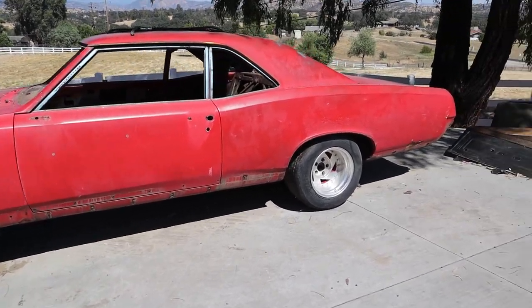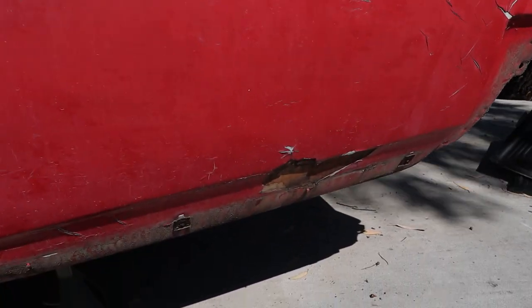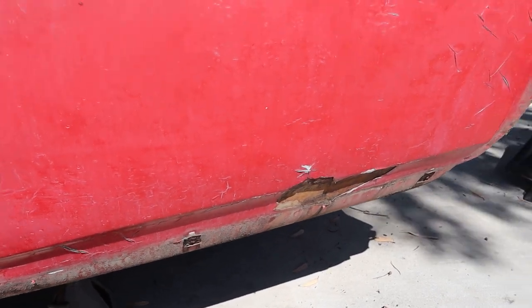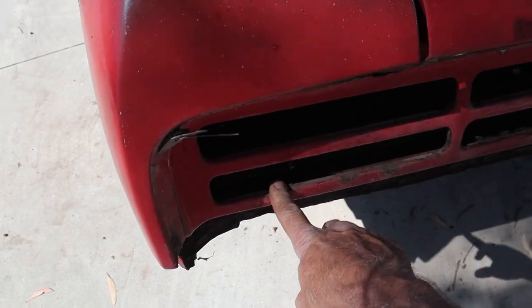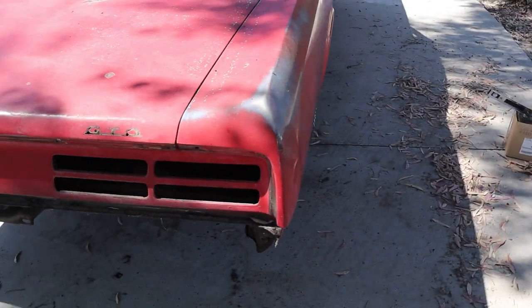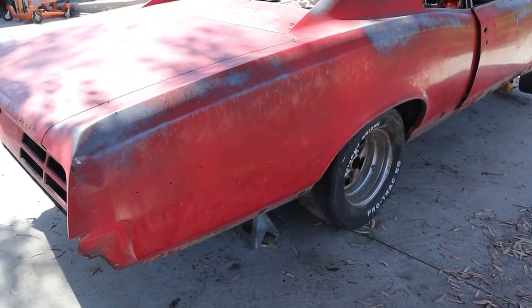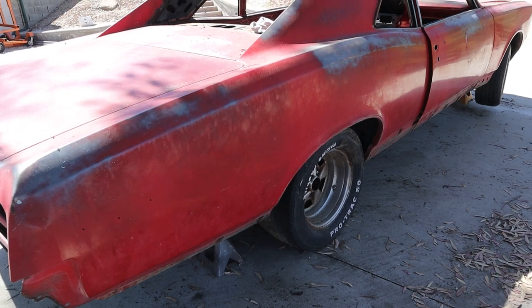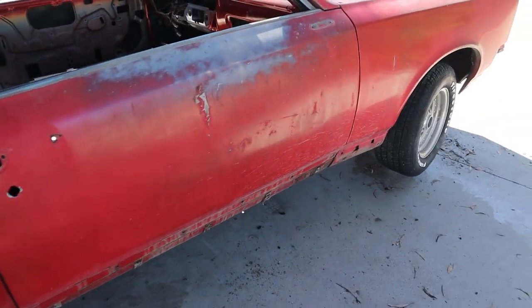Ruby's looking more stripped down than she was, that's for sure. We got a good day's work in. I was just looking at this down here once I got that molding off — that looks worse than it is. It's actually less than an eighth of an inch thick; I just peeled some off. But we may need to put patch panels down here anyways — could be rusted out. We'll find out once it comes back from being dipped. Back here around the tail lights I was really concerned because there was a lot of rust right on the edge, but it's pretty sound — feels pretty good, so that's good news. I really wish I would have stored the car better. It certainly wouldn't be in this condition. I stored it at my sister's for a while, stored it here, tried to keep it covered. But once stuff gets in there and the rain gets in, it just turns into mush — the water just sits there and causes damage. But it's all here and I can deal with whatever we find. All in all, it's a pretty sound car.